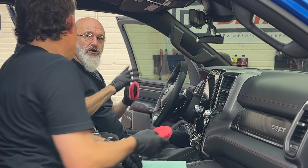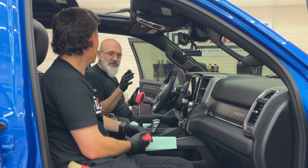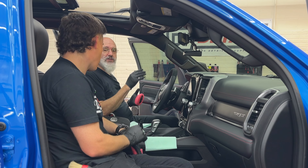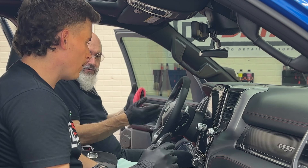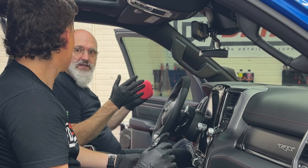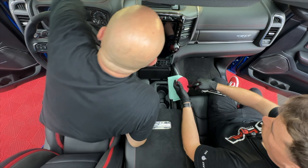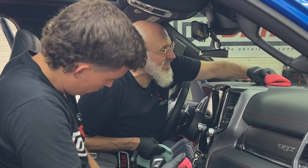The interior ceramic goes on every surface except your windows. You can put it on the windows if you want, but we never want anything hydrophobic on glass because it can cause fogging — not something you want on an interior window. So stay away from your windows. We're putting it on the applicator pad. I've already got my applicator pad dampened and I'm applying it to Alcantara first, working it in in different directions.